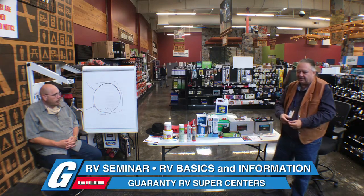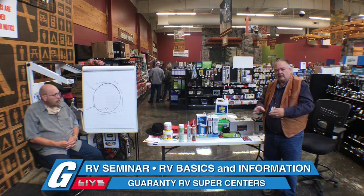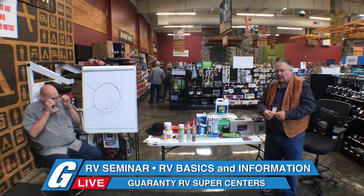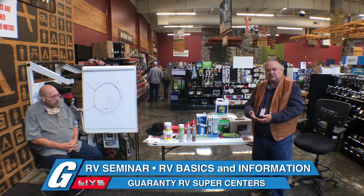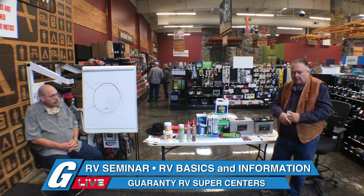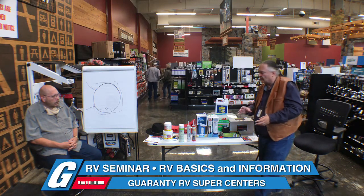The last thing I like to talk about is tires. A lot of times people's first coach is used, and the used car salesman says, 'Look at those beautiful tires.' The problem is that coach is 12 years old — those tires are probably 13 or 14 years old. In our industry, our tires don't wear out — they age out. When you get to eight to nine years, that tire is aged out. The cords sit and you get a flat spot, and then boom, you blow a tire.